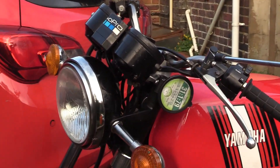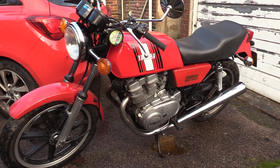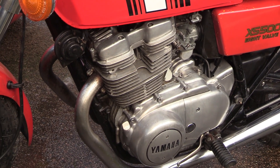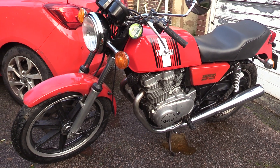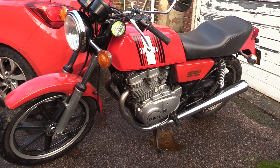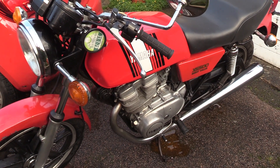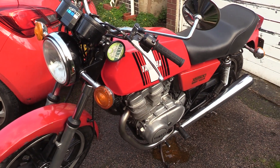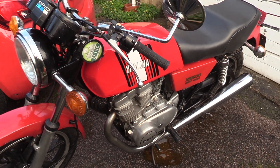You can see I've got a non-authentic tax disc to suit the bike when it first came out. One of the problems with these bikes is that behind the side cover is the oil filter, and you cannot get the oil filter anymore because it uses an M22 thread. Those M22 threads are non-standard and Yamaha ran out of stock years ago. What is available is an adapter plate — you remove the side cover and the plate, and fit a new adapter. There's a third-party one that lets you use an FZ600 oil filter, which is standard size thread.